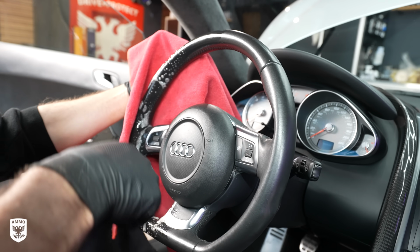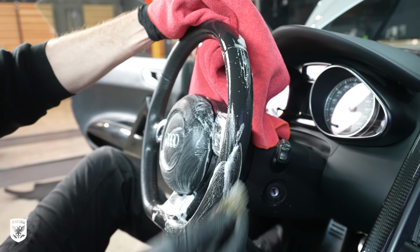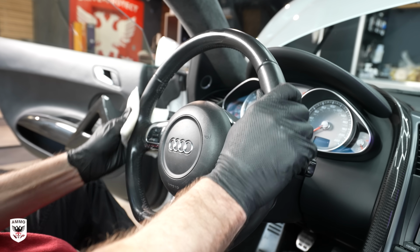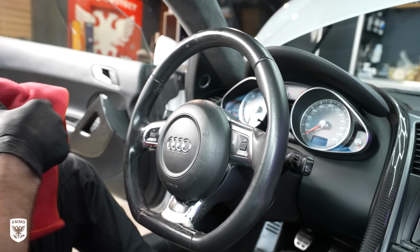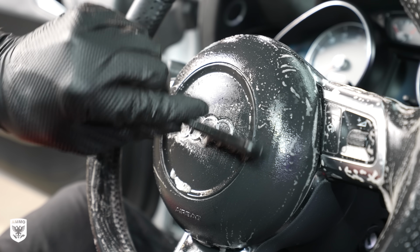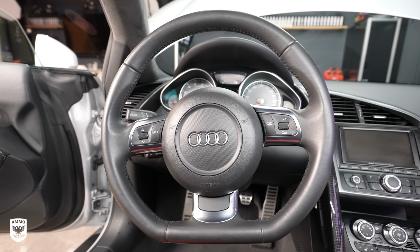With the outside now clean, I then cleaned up the interior with lather, especially the original leather steering wheel that has a tendency to absorb hand oils. When the leather gets this old and is cleaned on a regular basis like I do, you need to be extra careful not to remove the color of the interior. So work extra gentle until you feel comfortable enough with the integrity of the material. Otherwise, it may come off unexpectedly. The skinny seam and stitch brush is ideal on sensitive string stitching, and notice the matte texture now on the steering wheel. It's much better and there's no shine.